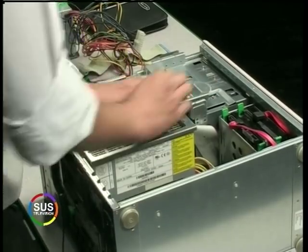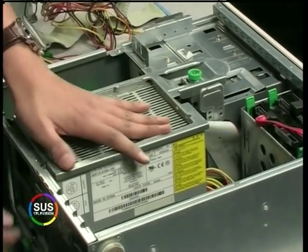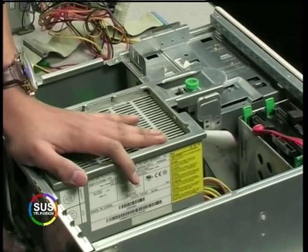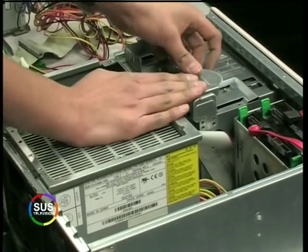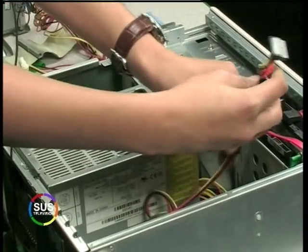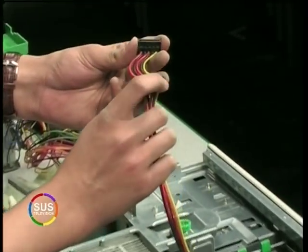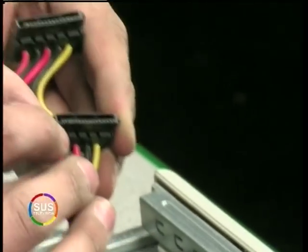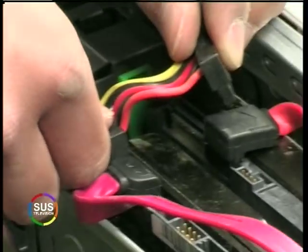So that's the hard drive replaced. Now the final phase is just to put the SATA power cables to our SATA drives. It's our black ones. They simply go in — and as with the SATA cables, they have a specific way which they go in. There's a sort of right-angled bit which bends down, and you can see on the connector there's a right-angle bit on the left if you're looking at it. So we just line it up and push down. And there we have it.